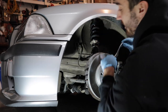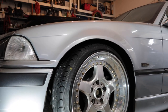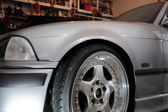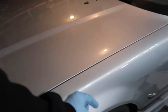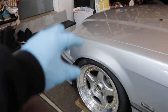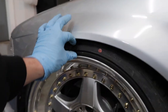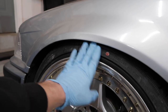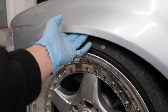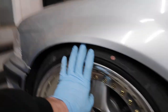The sway bar bushing is like totally compressed. It looks like we got about two more turns - we're like maxing these out. So the coils are honestly close to max. Ride height's not bad but I want this tire to be closer to the fender because going fender to lip will make the car extremely raked. I'd rather just space this out a little bit. We're going to go to the 540 and steal its spacers, because the rears have the size I think I need.